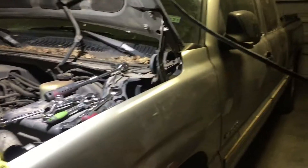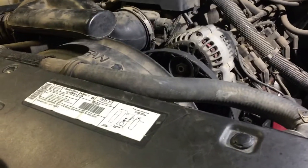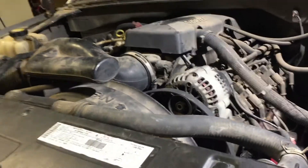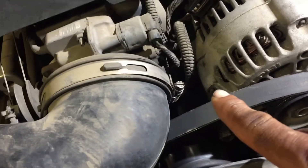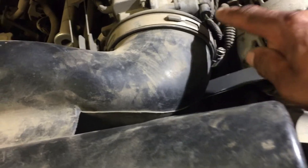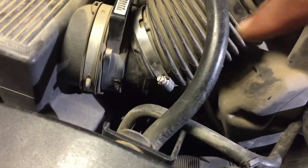All right YouTubers, we're working on this '99 Chevy pickup 1500 5.3, we're gonna be changing out the water pump. I've already changed it out but I slapped everything back together because I ran into a problem and I want you to be aware of this. We'll start off here by taking this off — you can use a screwdriver or it might be a 10 or 8 millimeter. Loosen this one and then this one, work it out, pull it back and it'll come out. It's kind of tight at first but as you lift it up it'll kind of automatically come off.